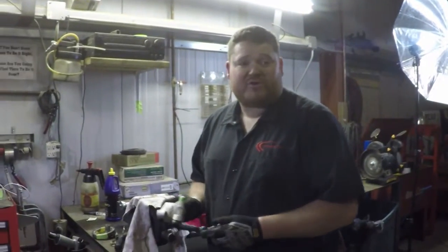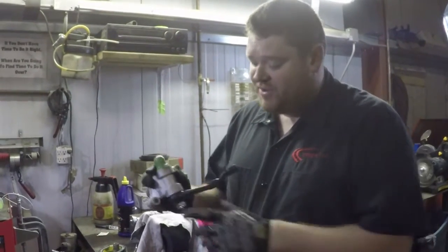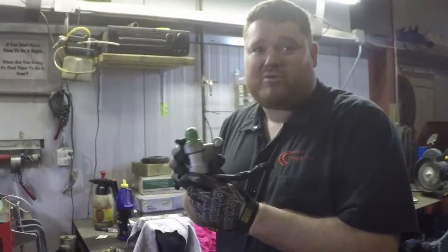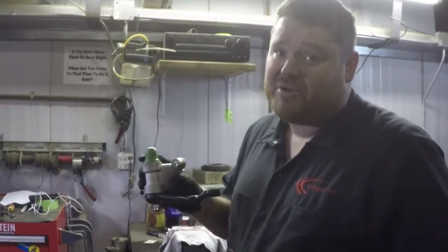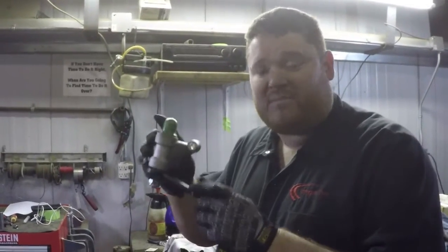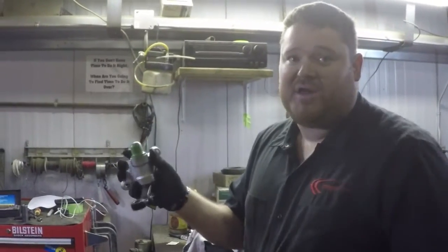While we're in there doing the steering box, we're also gonna replace the idler arm. The one in the car is not worn, but this is an upgraded one that has steel bearings inside instead of hard rubber bushings that wear out. I much prefer this style and I find they give a better steering feel. So while I have all the linkages out, it's the best time to put this in. Just undo two bolts, pull the old one out, bolt her back in place, hook everything back up. Simple.